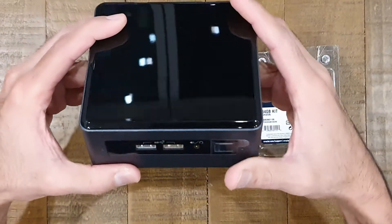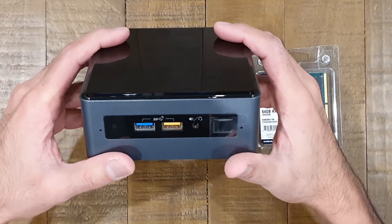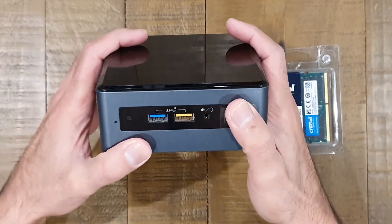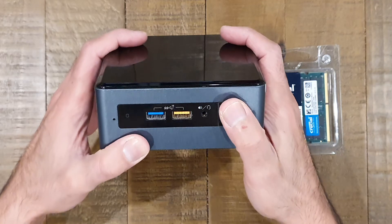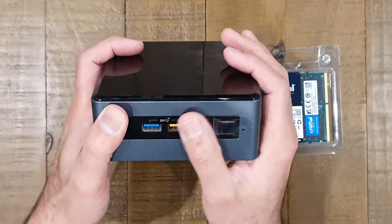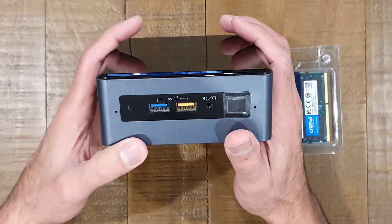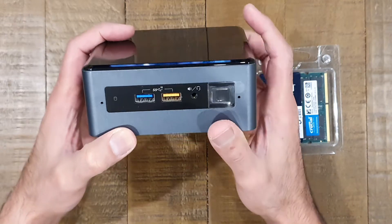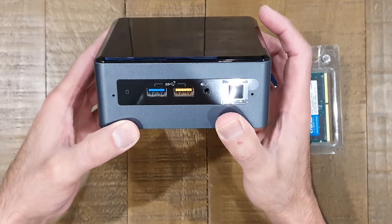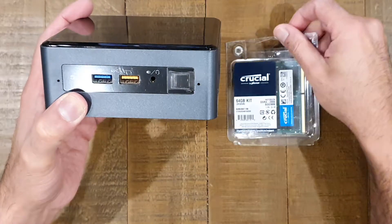I think these models, when they were advertised on the Intel site, were listed as only being able to support 32GB of RAM max. But if you actually look at the specs for the processor on the Intel website, it will tell you the processor can handle a maximum of 64GB. I know this will work because I have three of these units and one of them already has 64GB of RAM in it, so I'm comfortably going to put this in.